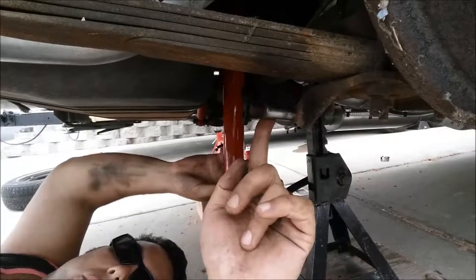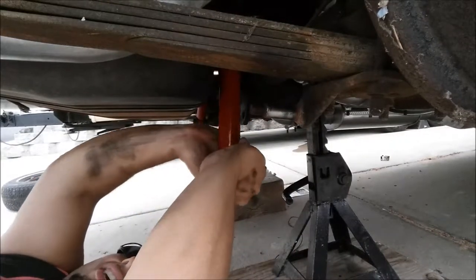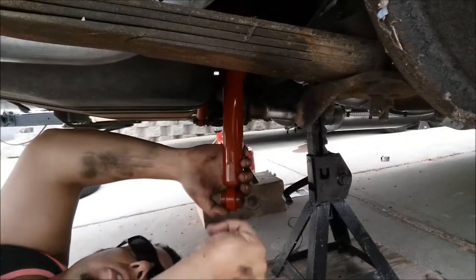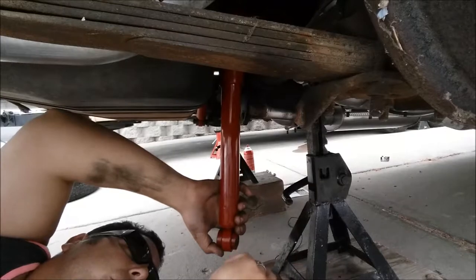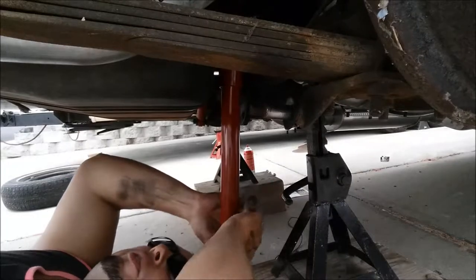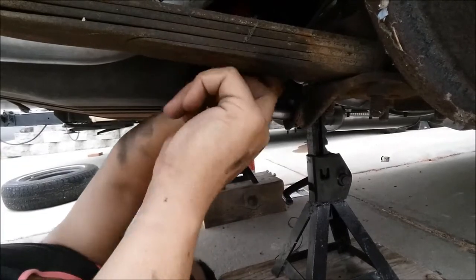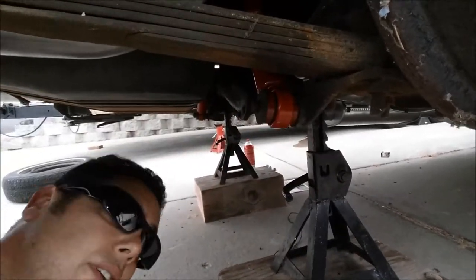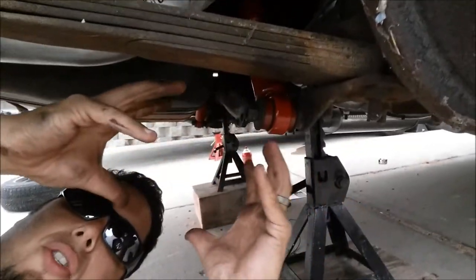When you're ready to compress the shock, you can see the bolt up here — it's much too long and that's fine. Use one or two hands, squish it, and then the fun part is trying to hook it on there. There are two washers of different diameter holes, so push it up and try to catch it as it expands onto the mounting point. That's the hardest part of the whole install. Once it's on, give it some good torque and you'll see the rubber start to compress.